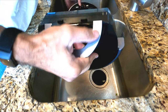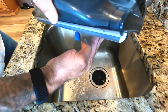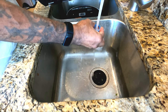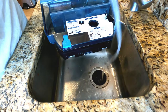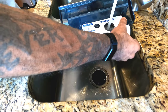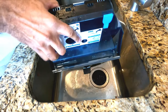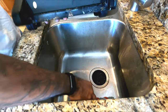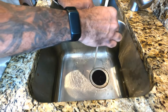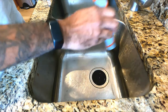When the reservoir is empty, you disconnect the tank. It stores dirty water in a separate section. The cleaning is pretty easy: dump out the remainder of the soapy water, and the air filter for the vacuum side comes out to rinse. This all feeds into the dirty water tank. Pressing a valve opens it to allow water to flow out. There are no electronic parts on that side. The scrubber wheel and bearing come off — if you have pets you'll get hair buildup that you can just pull off. Rinse everything off. The brushes are replaceable and don't last forever since it's a scrubbing brush.